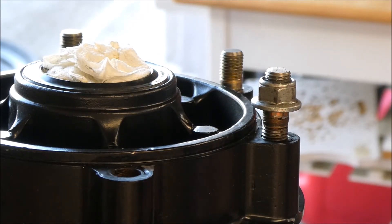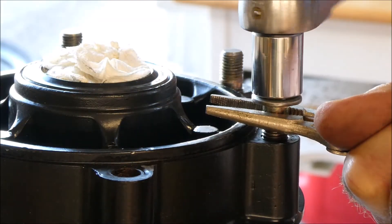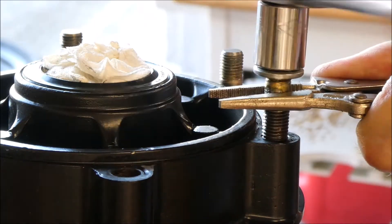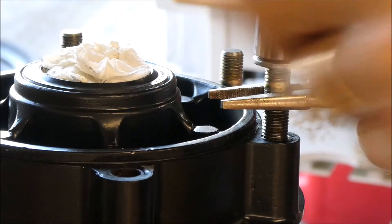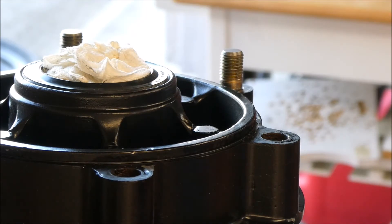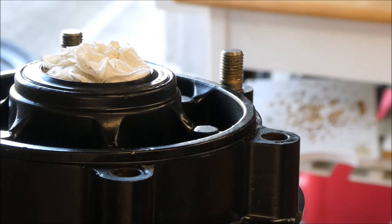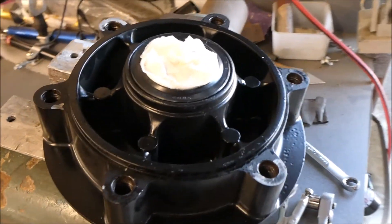I have to get that nut off, but I'm able to grab this guy just enough. There we go — it's all working out. I'll repeat that three more times, then package this carrier up for my friend Julian. Hopefully he'll be able to make time to machine this thing down. I wrote it down: 4.3 millimeters. And I should have perfect chain alignment after that. Mission accomplished — pulling the studs out of the sprocket carrier.